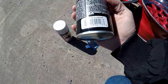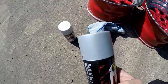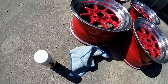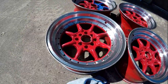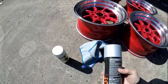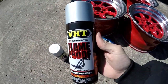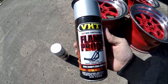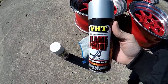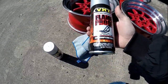The color I decided to go with is flat aluminum. All the red except for the hidden areas is going to be flat aluminum with a polished lip — I think it's going to look pretty good. A lot of people were asking what paint I'm going to use. Believe it or not, I'm going to use paint made for headers, simply because it's strong, durable, and doesn't fade. It's like 2000-degree paint, so it'll do pretty good.